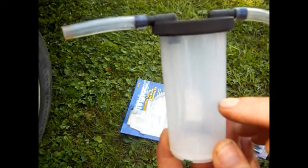There should be no air left. When the fluid comes down that tube in there, it will fill this. That way, when you let off the vacuum on your pump, if it tries sucking back, it will suck only fluid. You can do this with a pop bottle — run a hose into a pop bottle with some fluid. When you do the old-fashioned method where someone pumps the pedal and holds it and you release the bleeder, when you go to tighten it, it will not suck air up. So always use a pop bottle if you don't have this system, because by the time it squirts and you go to shut it, you can get air.